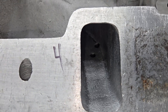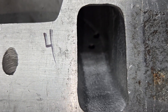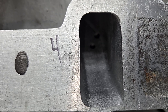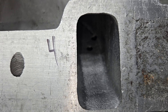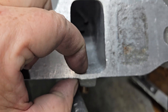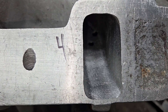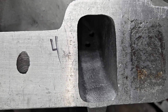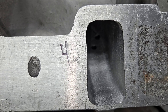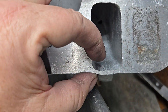Looking at number four, you can see the outline of the gasket - that's the 1262 Ford gasket. I traced that gasket from the blueprint project because he brought gaskets, which was great. This is an absolute minimum thickness for gasket retention. When I was all done and going to test this on the head, I thought I had the manifold about where it needs to be - most runners are right around 250, still below where I wanted. I ran the borescope through it and we had an interference on the top.